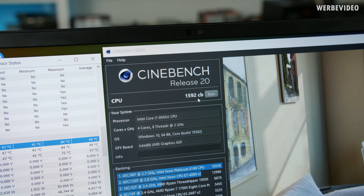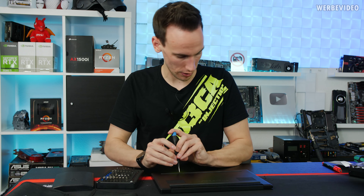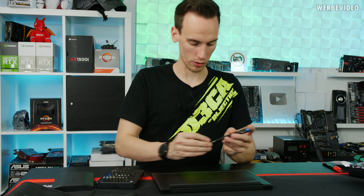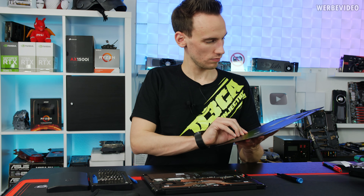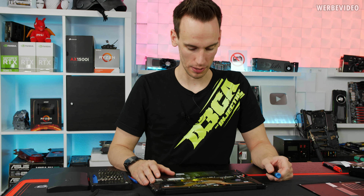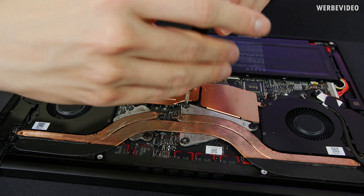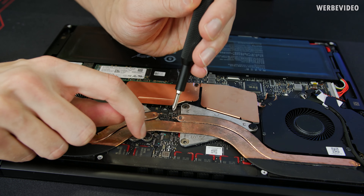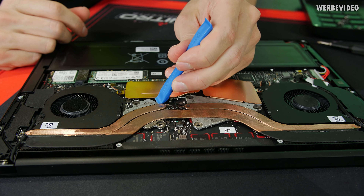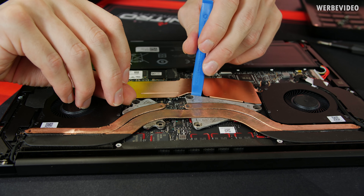The previous video was shot in March and now it's July, so there's a significant ambient temperature difference of three to four degrees, which could explain the slightly higher temps. Running at PL1 with 25W we're seeing 66 degrees Celsius — that's in line. Score is 1592 points, so it even improved slightly from the previous 1581. No degradation. Opening the Blade 13 is quite convenient — just 10 small Torx screws to remove the back.